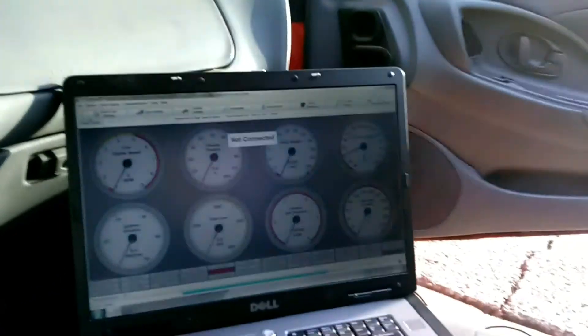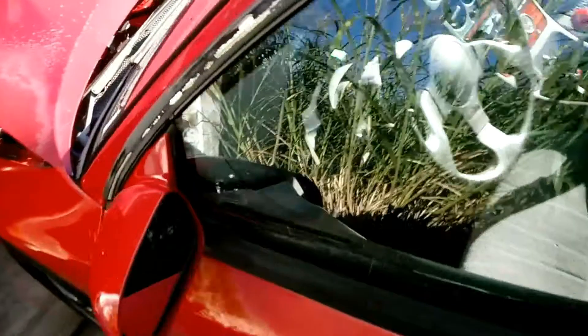I'm also going to put this coil pack back on the car — this one is off of a much later model PT Cruiser, so hopefully it'll do a little better. With the fresh gasket and clean throttle body I'm going to go into the engine bay, tidy up a few things, and then show you guys a quick start with the laptop on so you can see the RPMs and everything, and that'll pretty much be the end of this video.